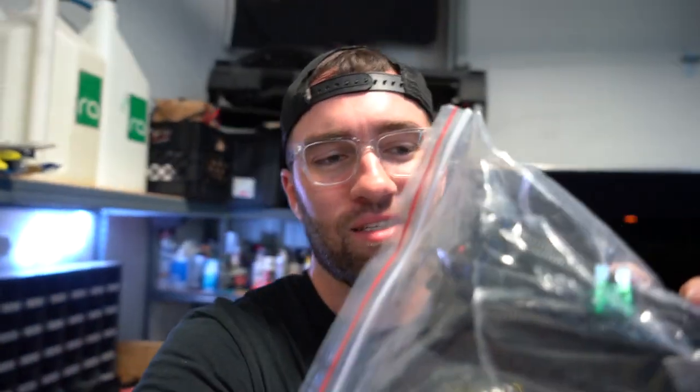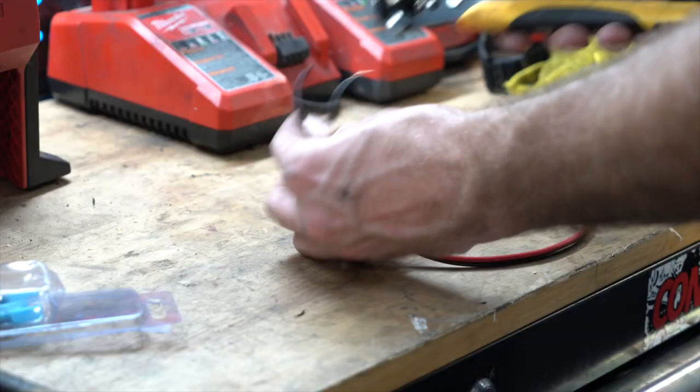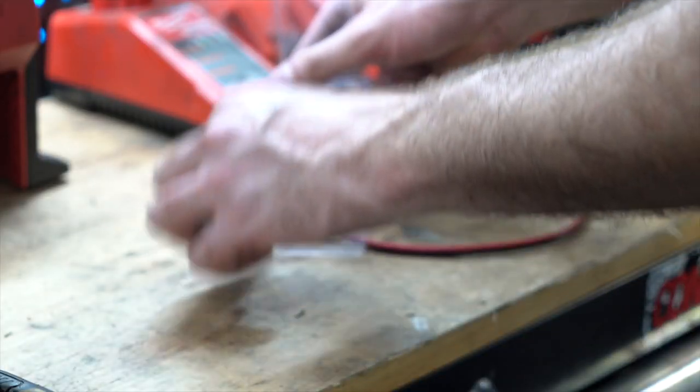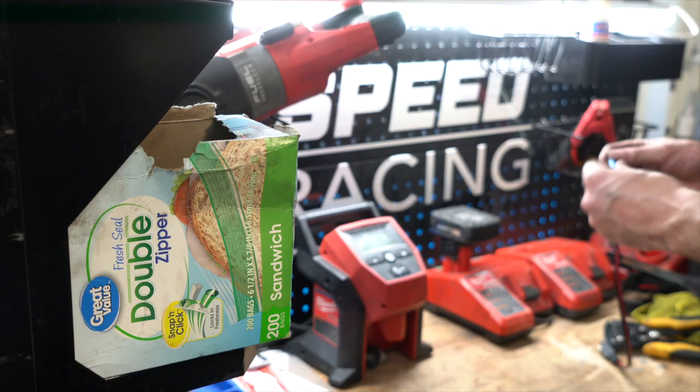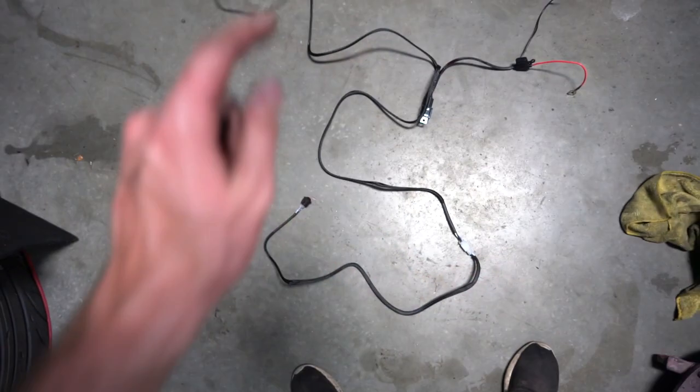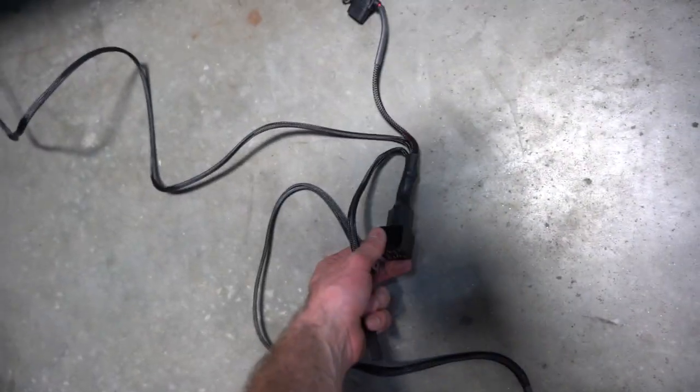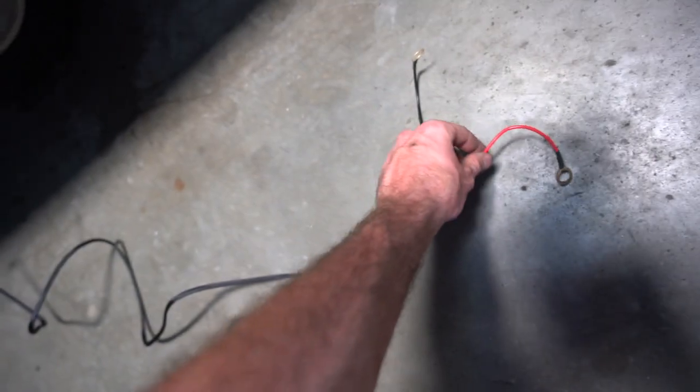For the wiring I have an Amazon wiring kit — they're about $10 on Amazon, already nicely loomed, and I'll leave a link below. We're going to wire this up to a switch so I can have it in the cockpit — whenever I want to cool down the tires I flip the switch and the pump turns on. These little harnesses are super nice: you start at the relay, then go to your fuse, which goes to your battery positive and negative — which is fused, which is very nice.